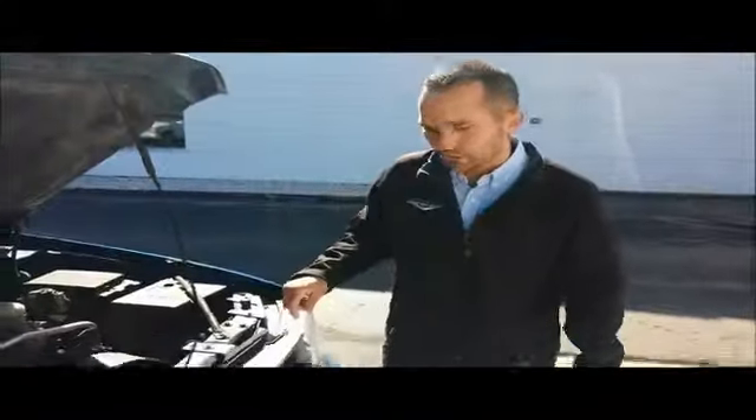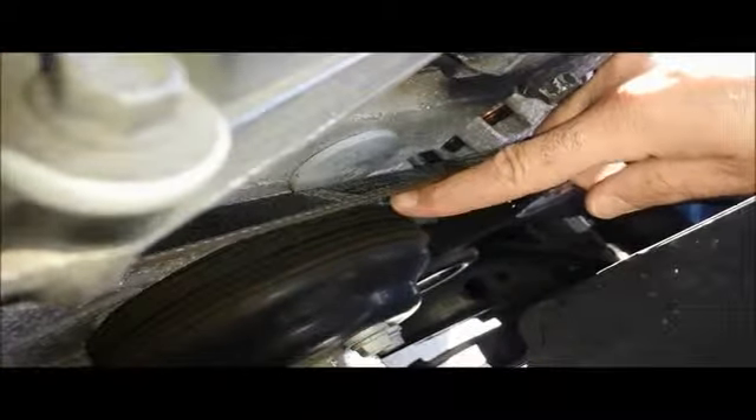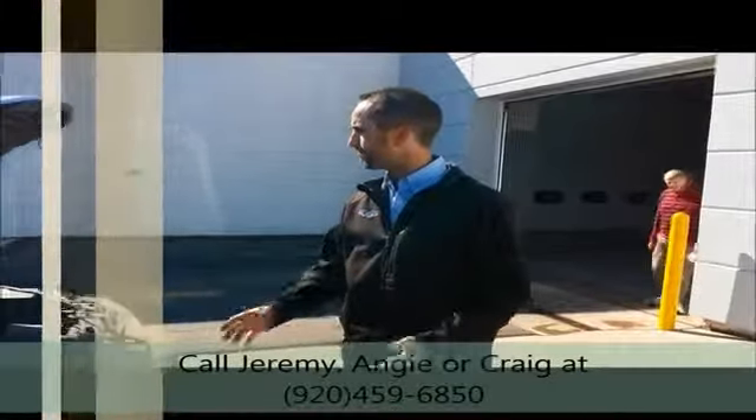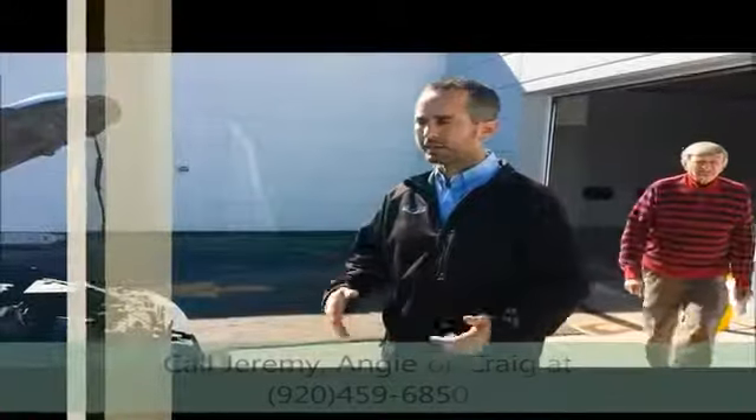The last thing that you can look at yourself is the belt. You can see in here on this vehicle the belt — look on the inside portion of the belt if you can see it. I see no cracking, just very good belt condition on this vehicle, so that belt is also fine. Other than that, your basic inspections — you're going to want to look at your lights and make sure those are working fine. Those are your basic look-at items that you can do visually without any testing.